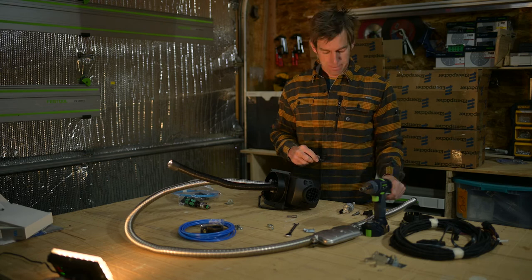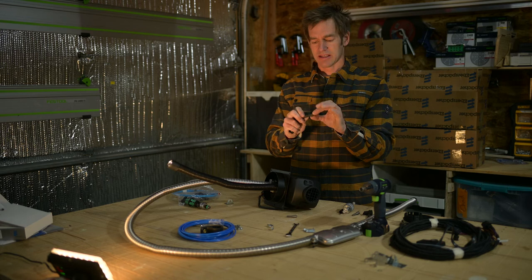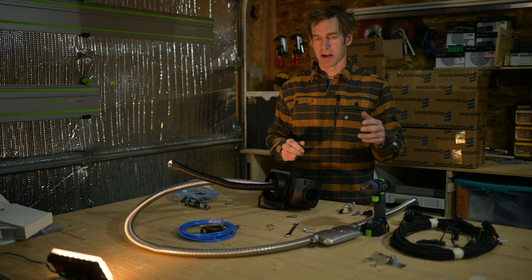One important thing is if you cut these in half and try and marry them on, there might be an instance where it bends and there's a little air gap and the fuel pump can suck in air, and you might get some fuel pump errors as you go, as you use the heater.